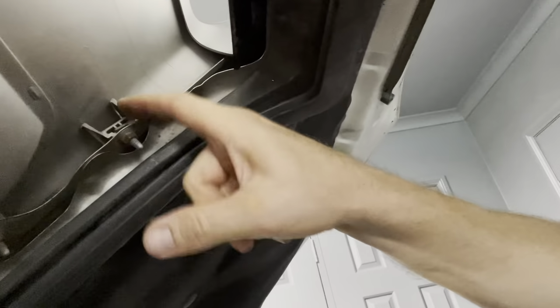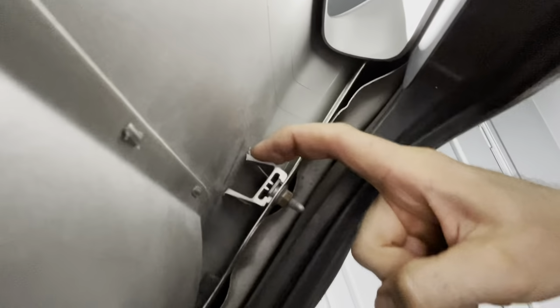Because I love putting up all my mistakes on this channel, I'm going to show you what I just did here. This is completely loose now, this one. I managed to over tighten it and it snapped the actual plastic. So I'm probably going to have to plastic weld that. Yeah, you're going to see it straight through the scoop. So a little bit of advice from here in my experience is just be cautious when you're tightening any bonnet scoops back on. Probably a rookie mistake.